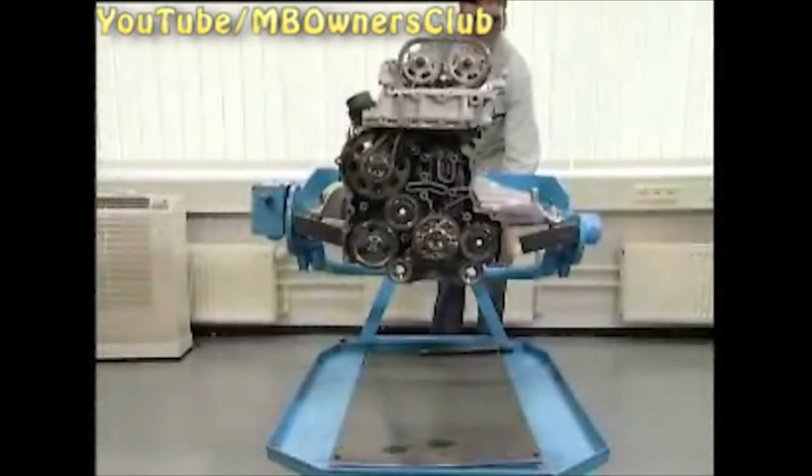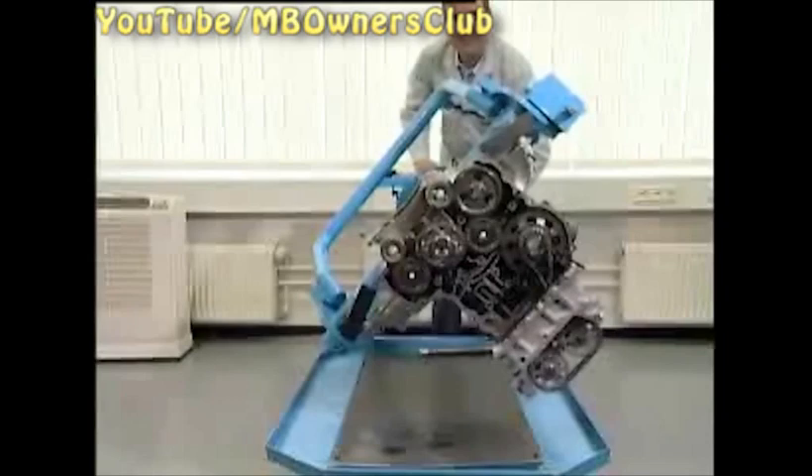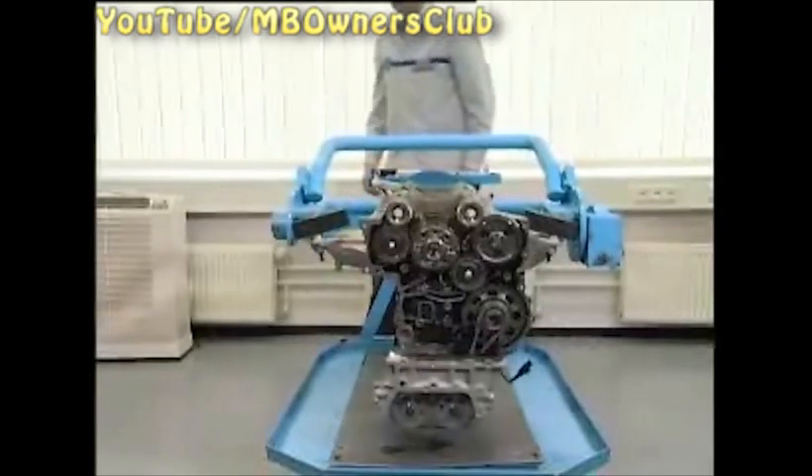The second example. Let's imagine you've repaired the crankshaft assembly of the OM651. Then you must set the Lanchester shaft on the underside of the engine. To better view this, we turn the engine over. The piston of the first cylinder must be at the OT position once again.